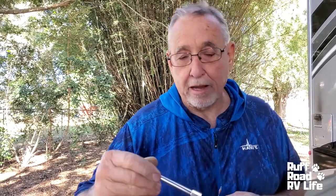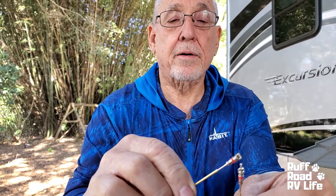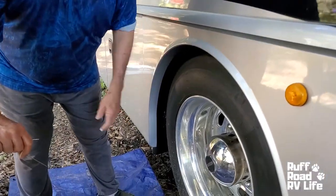If not, I can put this back in and unscrew that extension and try to get back between those two tires to put this on, which I don't want to do because I am not built for that. Now if you can see this very closely — see there's no little valve coming out of the top of that, it's actually stuck in there in that little hole. This is what it should be right here. So there's the difference between the bad valve and the good valve — this thing here actually depresses to let the air in. Hopefully all I've got to do is put that in and we're good to go.